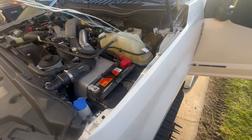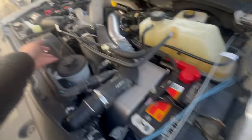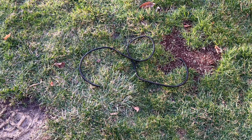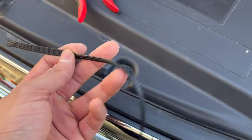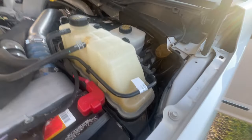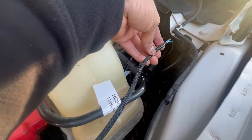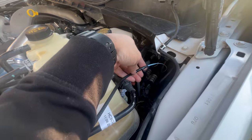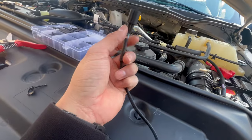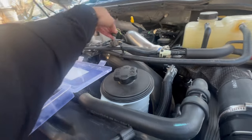We're just going to pull it out as much as we can. I'm going to see what's the cleanest way to do it — go through here, under here, and that's where it's going to mount. We're actually not going to use the wire loom that comes with the kit because I don't like the way that looks. I have some leftover braided nylon and we're going to use some shrink tubing. Cut it to size, pull it out toward the engine bay, use tape where you can't fit the shrink tubing, then feed your wire connectors inside the plug before it goes on your CAC connector.